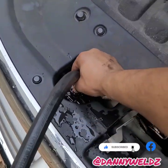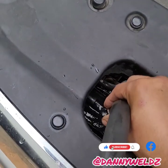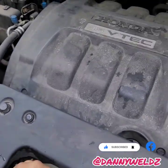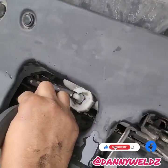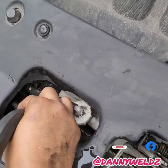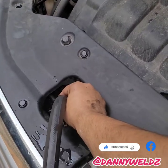I'm going to put the coolant in straight through the radiator and flush it out like that until it's clear while running the engine, because whatever you put into that coolant overflow reservoir is just going to stay in there. Remember what I said about putting cold water into a hot engine.